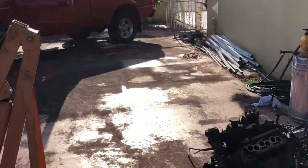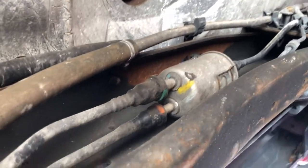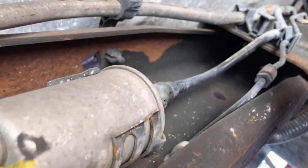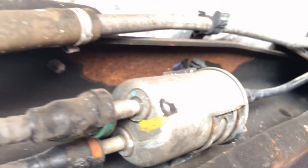The main deal is that we finish up on the Ranger. This isn't going to take very long. I had a chance to look at the fuel system when I was done with the Sawzall. Let's check out the fuel system real quick. I could already tell by the front that it was a returnless setup. As we can see down here, it's got the regulator all-in-one type setup. It sends one fuel hose to the front. We'll probably just delete this. I could either put the regulator in the front and do a return setup, or put the regulator back here and just send one line to the front and do returnless. That's for me to decide.